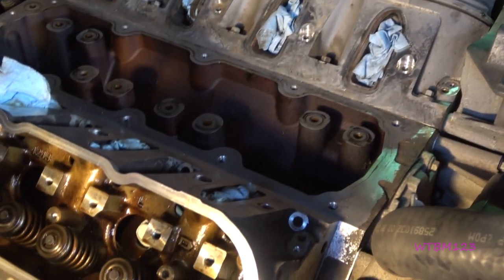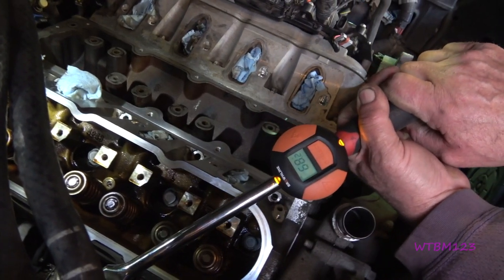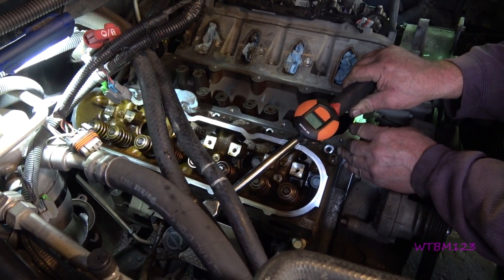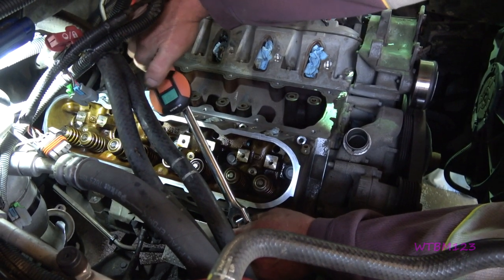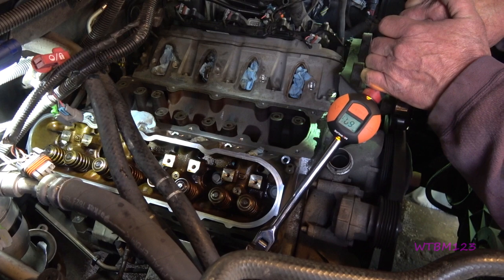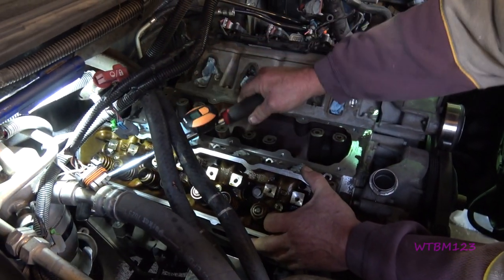That is a lot easier than trying to hold the dial and make sure nothing slips. Slow down when you get to the yellow. It seems like it's almost one degree early, but that's good because at 69.7 degrees you know before you get there and you don't go over so easily. That is a lot easier than having to stick that little prong down and hold it — much easier overall. We'll try this when we get it in the car and start doing the head bolts.